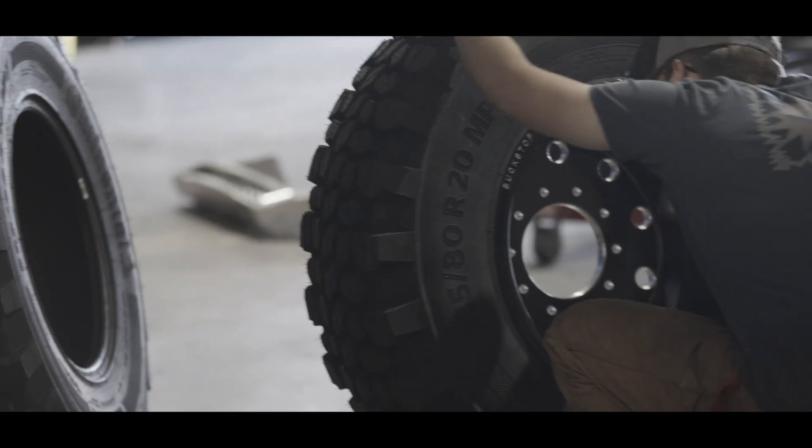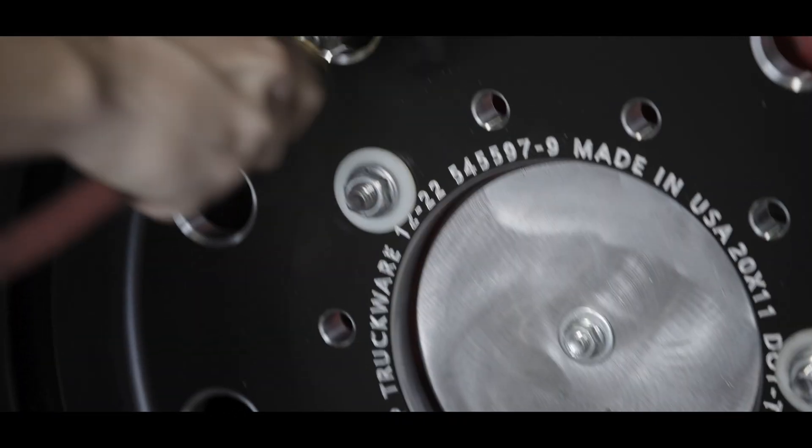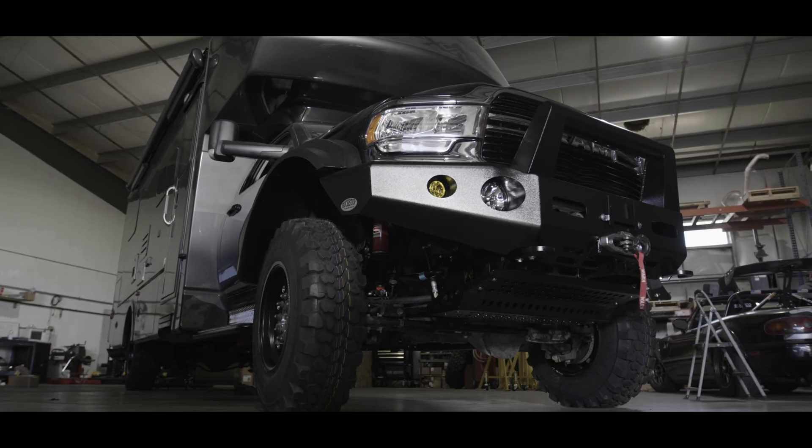To get the same weight capacity on four tires, we need the 41-inch military tire, which creates the need for custom wheels, suspension lift, custom fender flares, custom bumper, and quite a few different aspects to build an integrated kit to put that single wheel kit on it.